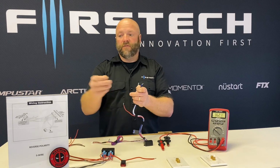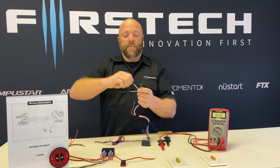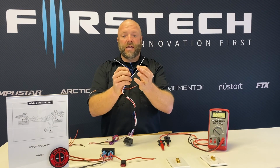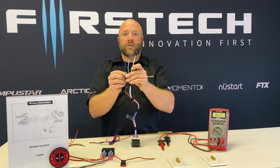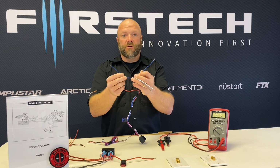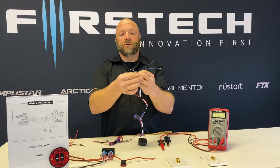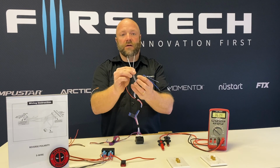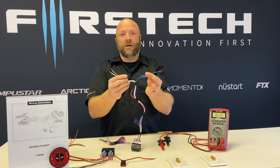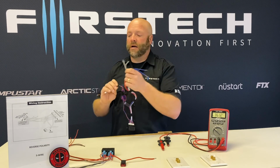And here you'll notice that I've got the instructions for this standing up here. The white and the white black are pins 87A coming from the relays. So these would be switch side. Pins 30 from the relays are the blue and the blue black. These would be motor side. Constant 12 volts. Switch side for lock and unlock. Black tracer denotes lock. Motor side for lock and unlock. Plug into the brain, 5-wire locks.